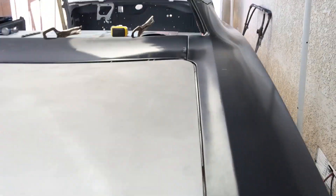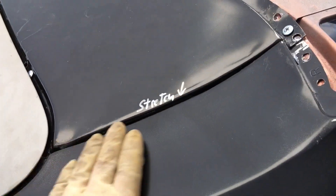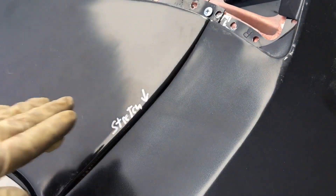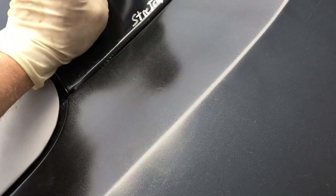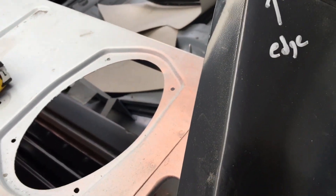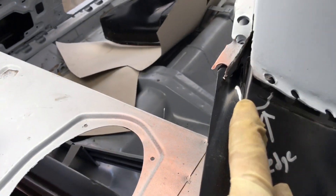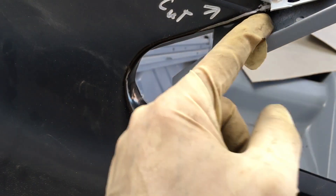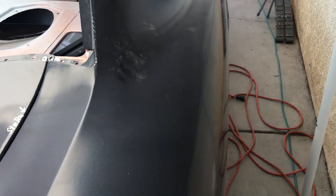The quarters aren't horrible but it doesn't quite line up perfect here, so I'm going to have to stretch that radius so it matches the quarter panel and the deck filler panel. I'll stretch the deck filler panel. Typical problem with all repop quarter panels — the edges are never as sharp as the originals. That's more of a radius up in there, so I've got to turn that into an edge. This is too long in here so I've got to cut that and pull it up so this will all sandwich back in. The quarters are actually on here perfectly square, measured all the way from the front.